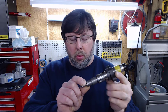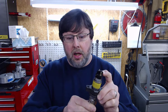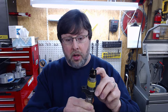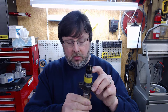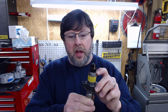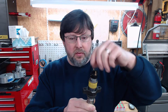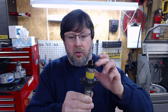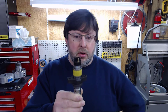Actually there's more calibration than that. We have the nozzle output, which is either a shim or a pointer. We've got a spring with a shim beneath it to set the spring rate. Up at the other end we have an armature with two return springs, plus a main high-tension return spring with a shim underneath it to set spring tension rate. Then there's an air gap adjustment shim and a shim to determine armature lift — how far it travels from the seat to allow actuation.